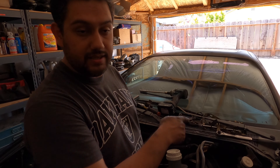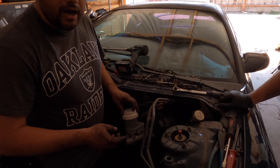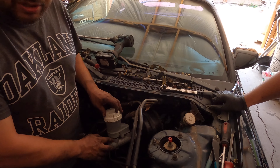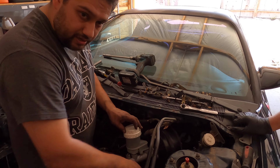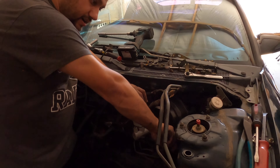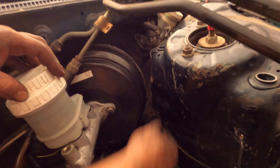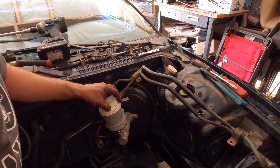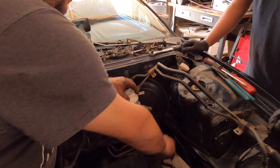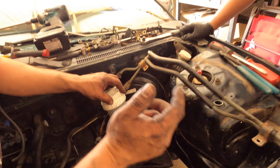We are about to put this guy back in here, but there is one thing you guys need to be aware of. Remember I talked about the bore being bigger on the 3G brake master cylinder? There is one thing you need to do — you actually need to dent this general area around here. You'll see once you try to mock this thing up because it actually touches. You just have to hit it a little bit, not super hard — don't get too carried away — but you do have to dent it a little bit in order for this thing to clear in this particular area.